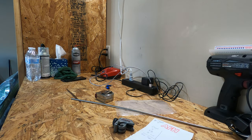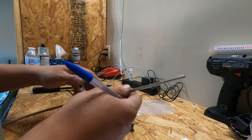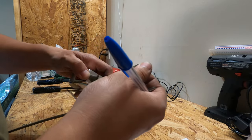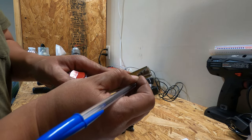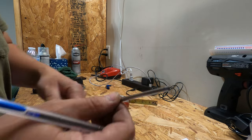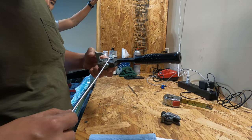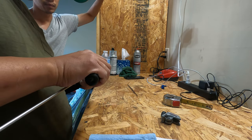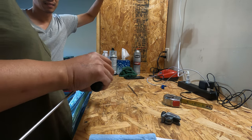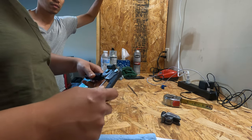Now we're gonna bend it. Should I use those copper rings too? No, you're all motor. A lot of people use it more for the turbo side. So we're gonna add an eighth. Remember to add an eighth, guys. Boom. So you always line it with that? Yeah, with the eight right there. You see it? Damn, I've been doing it all wrong. I just learned that right now too. Because usually with the other benders, you don't have to use the flare tool. You just put it in there, you tighten it up, and we're done.